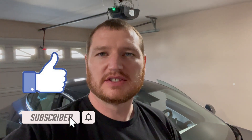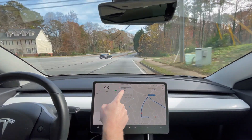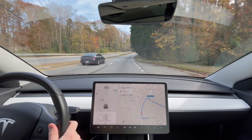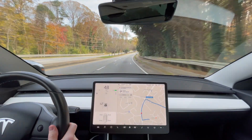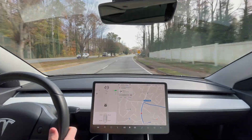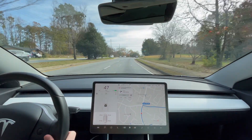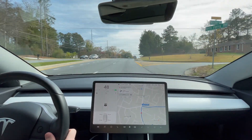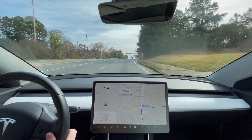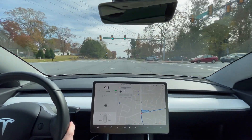If you like this video, make sure you give it a thumbs up and subscribe for more content like this. Just like we did with the Model Y, we're going to go for preconditioning the battery to get over to the supercharger. That'll help warm up the battery pack a little on the way over there. We've got the tires all aired up — they're at 45 psi right now. I expect them to get up to maybe 47 once they get warmed up on the interstate.